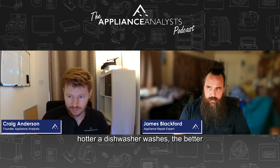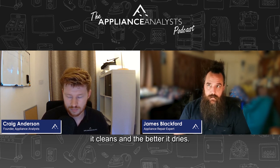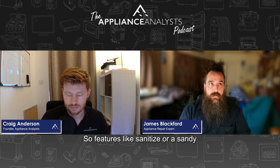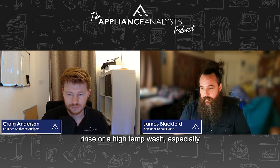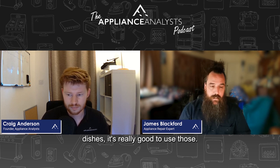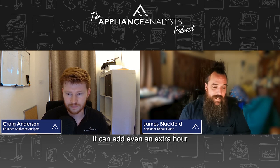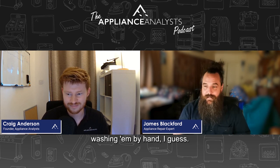But the hotter a dishwasher washes, the better it cleans and the better it dries. So features like sanitize, sani rinse or a high temp wash, especially if you're washing really heavily soiled dishes, are really good to use. It can add even an extra hour and a half onto a cycle, but that beats washing them by hand, I guess.